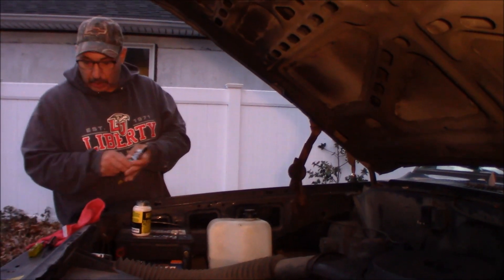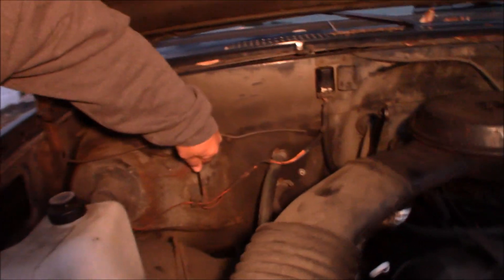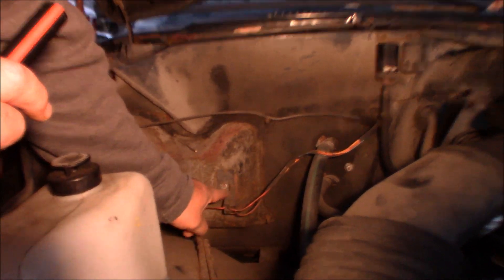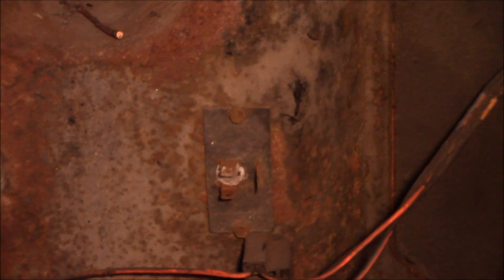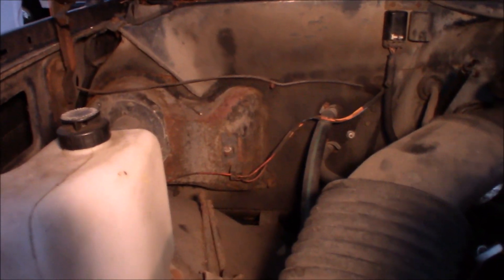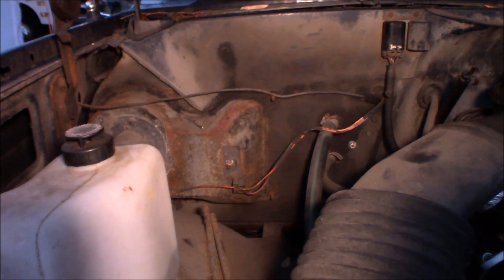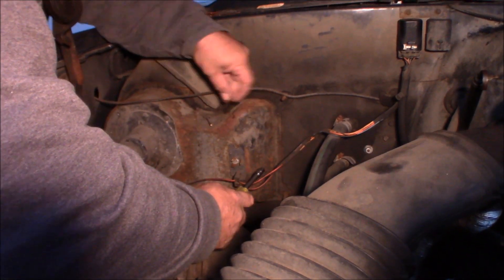Usually you'd use a nut driver, but this is an '87 and I'm just trying to pry the harness off because it's pretty crusty in there. You can see how rusty the connections are. There are just two little tiny bolts with screws — they're metric, because it's an '87. These mid to late '80s GM vehicles have a mix of metric and standard. Seven millimeter — little sheet metal screws.